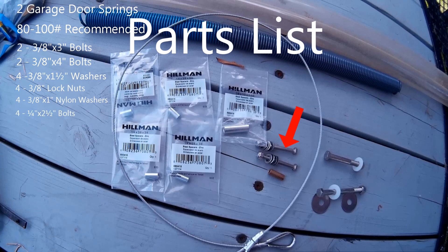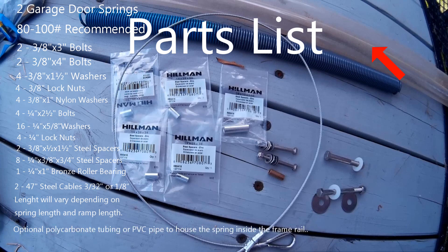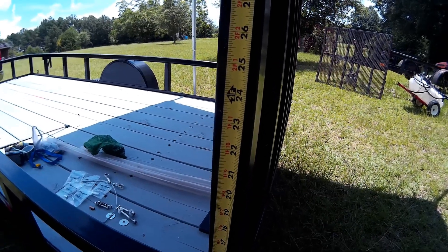In this picture you'll see some polycarbonate tube. This tubing is not necessary — I had it laying around so I used it to prevent friction between the springs and the inside of the rail, no metal-on-metal rubbing. You can use PVC pipe if you can find some to fit, but again it's not necessary. All right, let's show you the process.